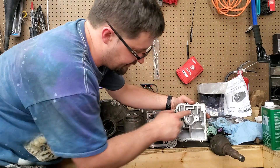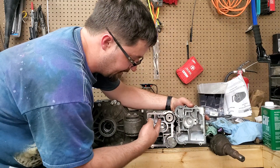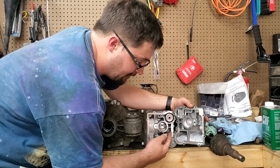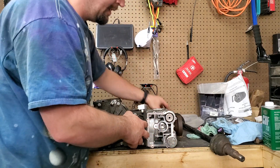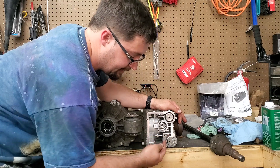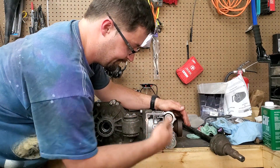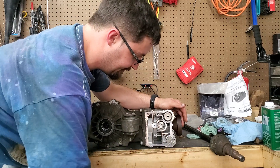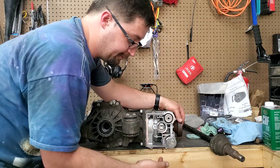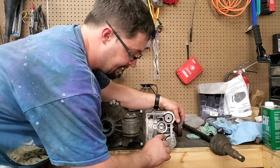When filling through the vent tube, it skips this portion and actually goes back into that portion — I'm guessing to help prevent fluid from going back out when it needs to vent pressure. This chamber coincides with this area right here; there's nowhere for this fluid to go except down into the reservoir. When you're filling it up after it's already filled to the top, it's pouring over and down where the pump is. Once you put the cover back on there's no fluid there, so if you only fill it up there your pump isn't going to have anything to push through the system.